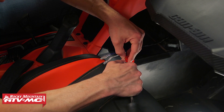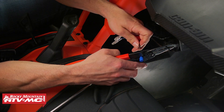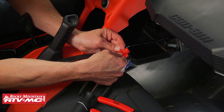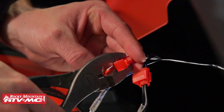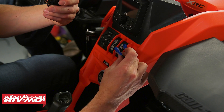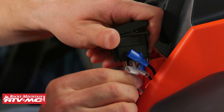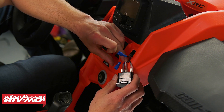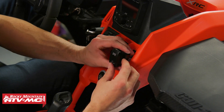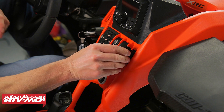We've got a couple inches of black wire and our wire tap to tap into this location. Once you're tapped into that wire, attach a spade connector to the end. Do the same thing with the white wire. Once you have your wires attached, reconnect these to your switch. White wire goes to number two — clipped in. Blue wire goes to number three on the bottom. Black wire to number eight on top. The wire spliced from the white wire, in our case a red wire, goes in the number six spot, and the other black wire goes to number seven. Before pressing this in, verify everything works — it just lit up and the top one's lit up with the light bar on, so we know we're good.